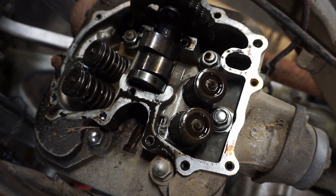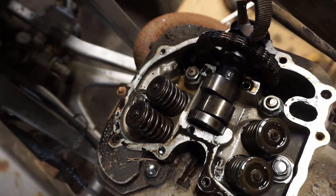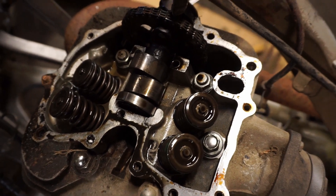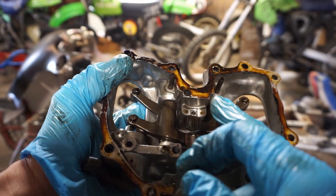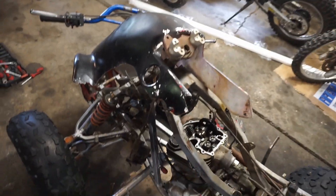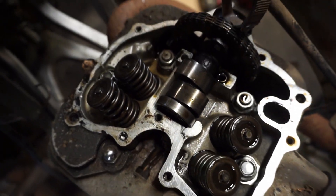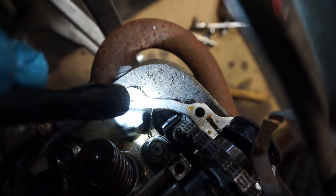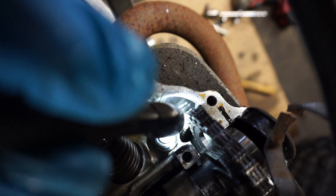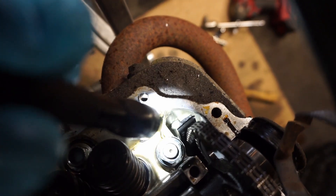That would actually be good because then the crank should be fine. I did break off one bolt — the front one snapped off, but not too big of a deal. The cam chain is still tight, so we might still have hope. I found where that pin went — it just goes right here, like these two. It must have just fallen out, so I don't think that was the problem. Inspecting the top of the cams more — something must have been grinding to make that rocker look like that. I can see a tiny chunk of metal down there — from the rockers or some piece that broke off. We have to be careful not to drop it all the way down when we take off the head.